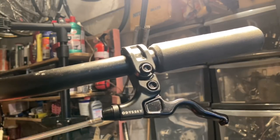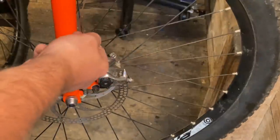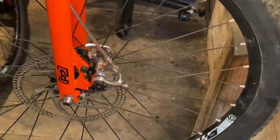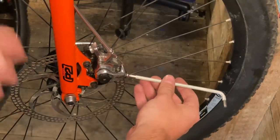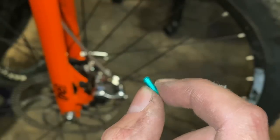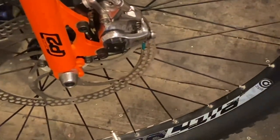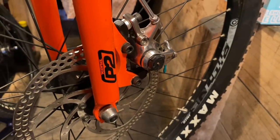Setting the brakes up was quite simple — basically just centering the caliper on the rotor and then it's all plug and play. In the long term these are going to be a lot easier to maintain, just for the fact that I will never have to bleed these. With hydraulic brakes, they work really great, and then one day you'll have a busted seal with brake fluid leaking out, thinking: why did this happen? Was I too hard on my brakes? Have I been neglecting them? Why can't I just ride my bike? But if you ride cable brakes, that moment will never happen.